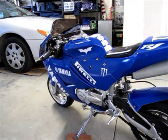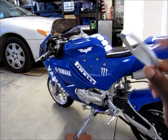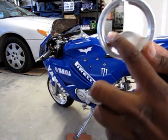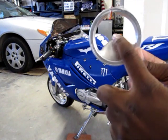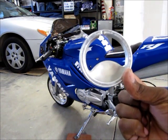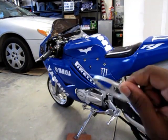My bike's back together. Here's the governor — it feels really cheap, like a little foil piece or tin. Here's the governor, and that's the piece. If it were all the way open, it'd have maximum airflow. This piece is up like that, so it's constricting the airflow — you don't get maximum airflow and you don't reach the full potential of the bike. So that's how you remove the governor off the X18 super pocket bike.